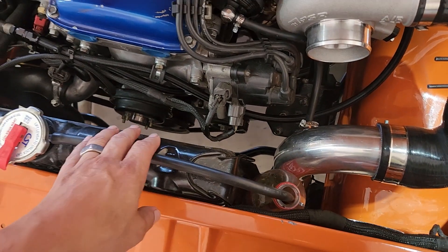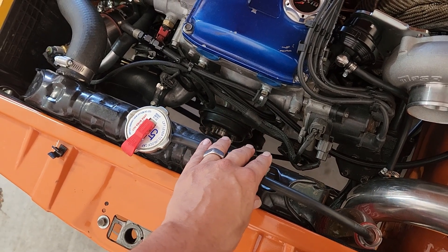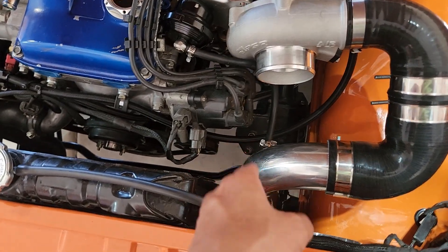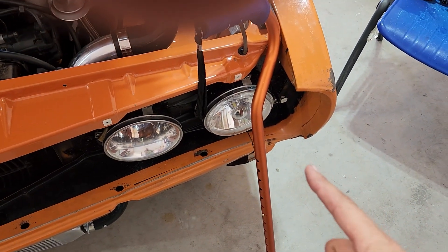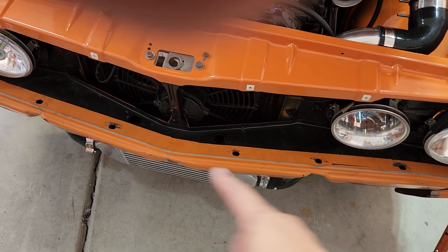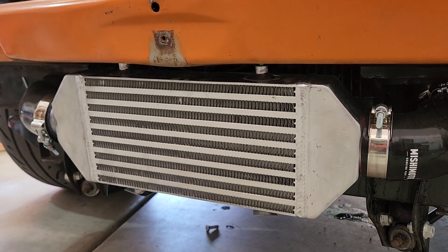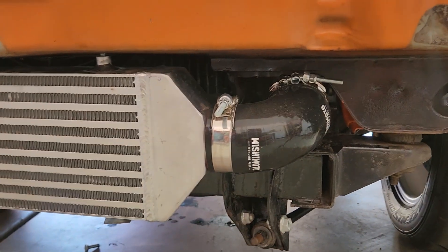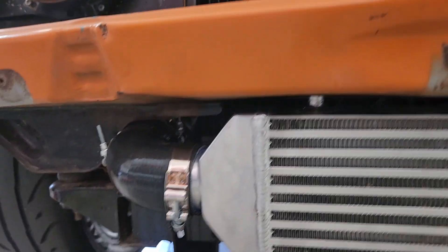This will probably only work if you're not running a 240SX radiator in your 620, because that radiator sticks way out and would block all this area. So I have a modified radiator here with an extra row put in by a radiator shop, which seems to be cooling things well. That allows me the space to run the pipe straight down to where the bumper bracket goes — which means you lose the bumper bracket. I'm going to bolt my bumper on with the two side bolts and make some custom brackets for the front. I chose this intercooler for a Honda Civic — probably smaller than a lot of people would want, but it's what fits in the space between those bars, and it lines up right where the stock openings are in the 620.